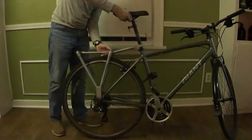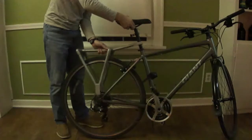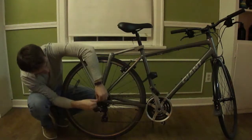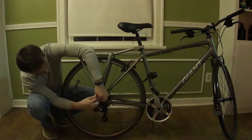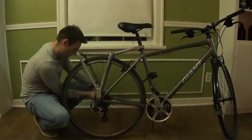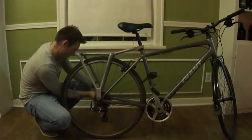The bike rack prototype proved to be more successful than I initially anticipated. The hot glue performs the functions of a fastener without the need for an additional tool, and the new rack rode quite well during a brief ride around the block. There was no noise from vibration, and the weight of the rack is merely a quarter of a kilogram — that's 700 grams less than the original Blackburn rack.